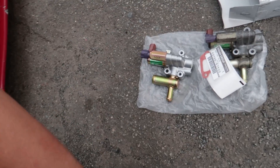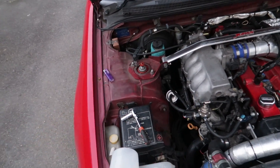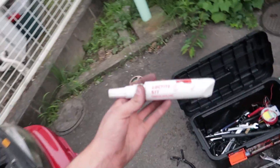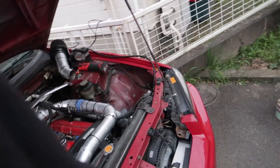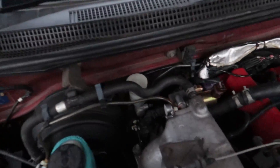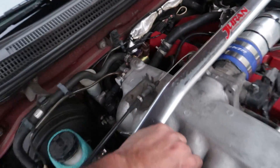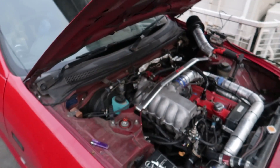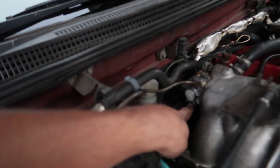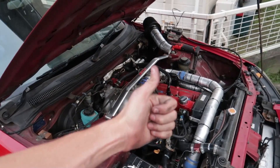I put the new gasket on as well. Just finished fixing everything — the fuel pressure regulator was super easy. I used this really awesome Loctite thread sealant on that, so it shouldn't be leaking anymore. The IACV valve has now been completely replaced and we got that whole new hose in there, so we shouldn't have any more vacuum leaks in those problem areas. The only thing I need to adjust now is the idle screw on the IACV valve — that definitely needs to come out a little bit.